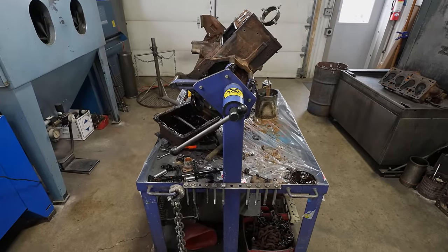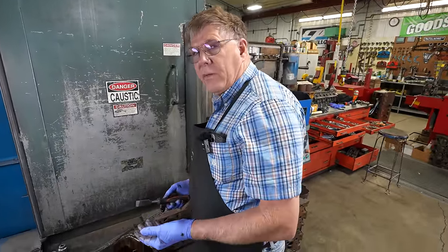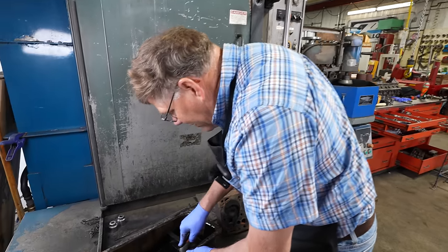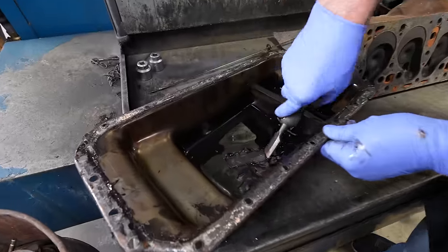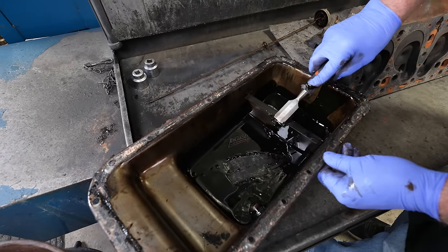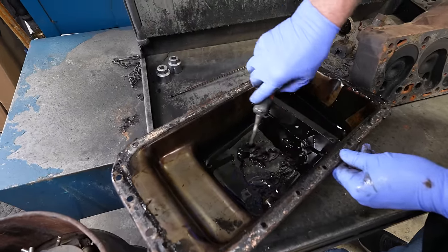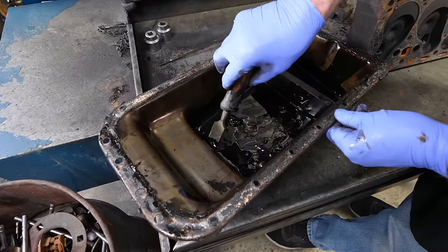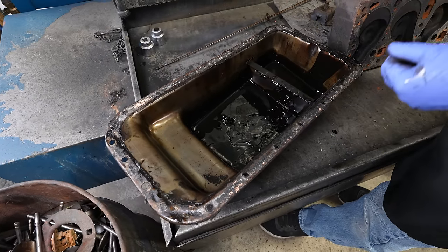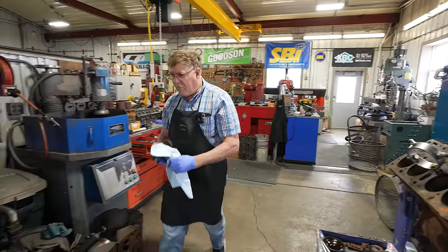I'm glad it didn't have any more oil in it than it did. It just had a trickle oil filter — it's not a full flow oil filter, so it just trickles a little bit of oil through that filter all the time to filter some of the stuff out of the oil. But on top of it, this one didn't even have a filter in it. Look here in the bottom — just chunks of sludge. This is just kind of how these old motors used to be: we didn't have very good oils, didn't have the filtration like we have now. It was not uncommon to have just a huge amount of sludge in the bottom of your engines, and that's why they didn't run that many miles. Years gone by, if you got 100,000 miles out of a motor, that was a huge success.